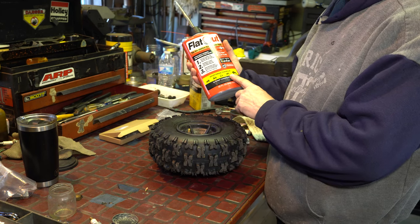I'm going to put this up to 14 PSI, do the other one, and just put these on. We'll put a little bit of blue Loctite on the threads because you don't want these things backing out and falling off in the snow — the customer will be very upset. Always start the threads by hand. Feels nice, spins nice. I'm going to spin this around a little bit to get the additive into the tires.